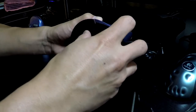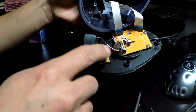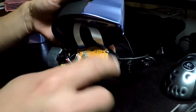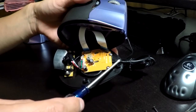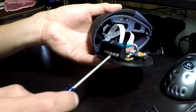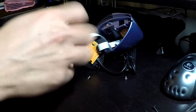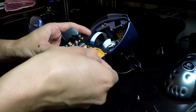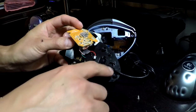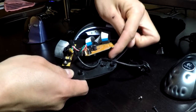From there you can pry off the bottom piece. You can ignore the taped-up portion — I tried to reconnect the wires with not much success. The problem is the cable: it eventually gets tweaked a lot at the top, the connection gets really weak, and the wires just kind of break. Next is to remove the board in front, which houses the sensor; the board in the back is just the LED light. There are only three screws there. The board pops off and reveals the wire routing system — the wire flexes back and forth right there and wears out over time.